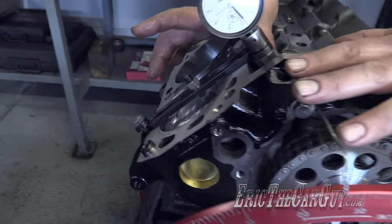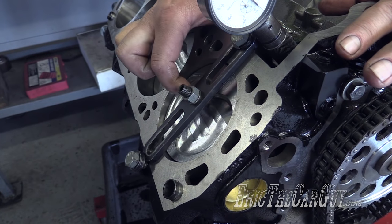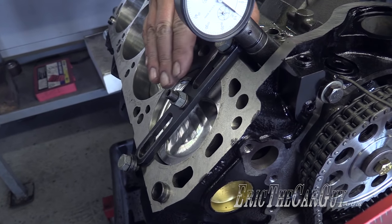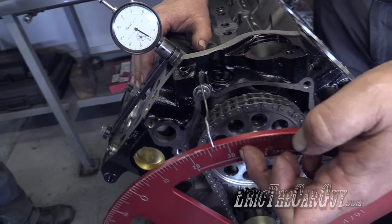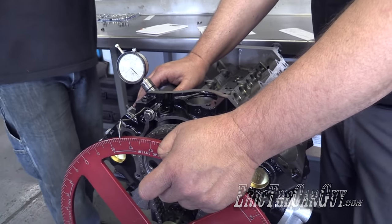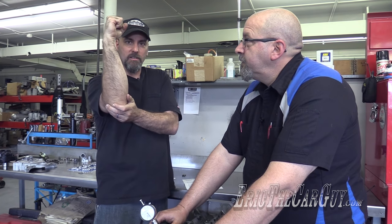This is all degrees of crankshaft rotation. I have installed a piston stop on top here. If you didn't have a strap to stop the piston, you could use a dial indicator — bring it down say 200 thousandths in the hole both directions to make sure you have the same reading on the degree wheel. The reason we do this is you can't visually just put the piston at top dead center, because the piston stays and dwells a certain number of degrees — it could be six degrees — where the crankshaft is still moving but the piston looks like it's standing still. You could be off four degrees, and four degrees can make a lot of difference in the operating characteristics of the engine.